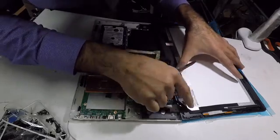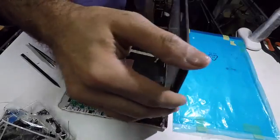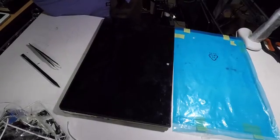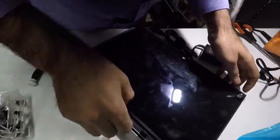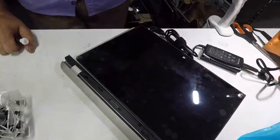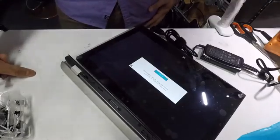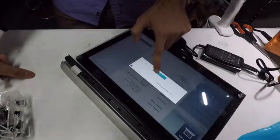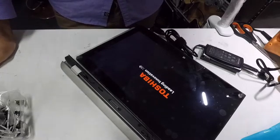Now it's finally in and secure, so gently lift the LCD up just for testing, and I'll get the charger and give it a go. We've got the charger plugged in — it's 19 volts, this one is designed for Toshiba. I can see a charging light, yellow color near the power button. Press the power button now, and there we go — great! It's complaining that the RTC battery is very low, which is understandable as it has been off for a long time. And as you can see, the digitizer is working and Windows is going to start shortly. There we go.